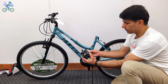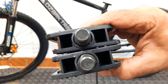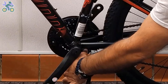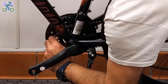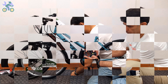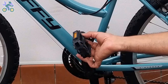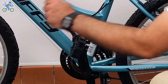To install the pedals, find the right side by checking the letters R or L labeled on the pedals. If there is no label, look for engraved letters on the bottom of the metal part. If the chain has come off the sprocket, reinstall it by placing it on the sprocket with your thumb and turning the pedal once. Install the pedal by hand only without touching the threads and without using tools, being careful to install the pedal vertically on the crank arm to avoid damage.